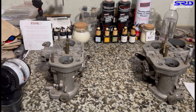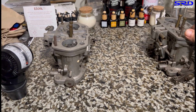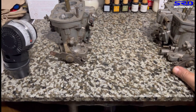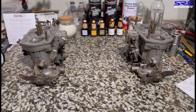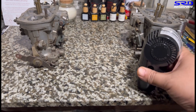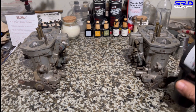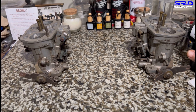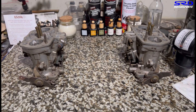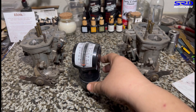It won't idle good. So we use this synchronometer tool — it pulls vacuum and shows a reading so you can see if the carbs are equalized or not. You disconnect the linkage or crossbar so you can adjust the idle stopper on each carb individually. This way you equalize the left and right, and then once equalized you adjust the crossbar linkage to suit everything perfectly — synchronized.